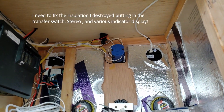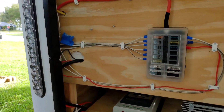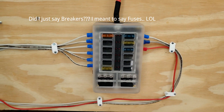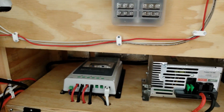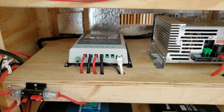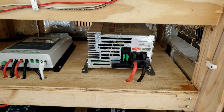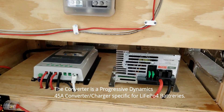I did a lot of storage left up here I'll be using as time goes on. You've seen the air conditioner. This is the DC distribution - I still got to put all the breakers in here as I wire up the switches. I'm going to build the cabinets and put the switches in, but the wires are all in. On the left is the 30 amp solar controller, which also has a remote indicator on the other side. And then on the right side is the converter - this charges the lithium batteries as well when you're plugged into shore power or running the generator.